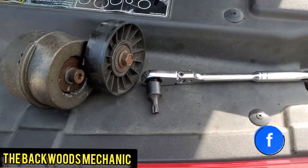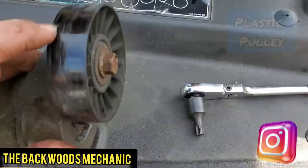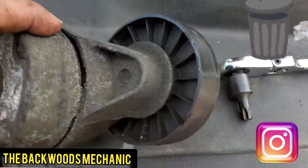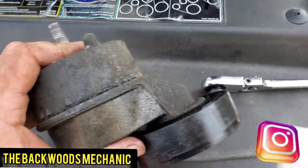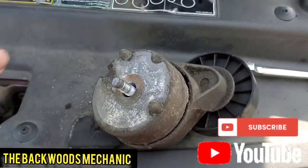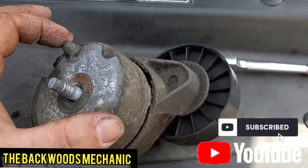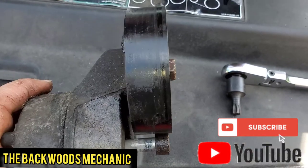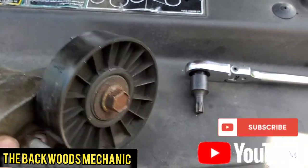Right here we go. I'm not saying that this is going to be easy, but it is doable and pretty convenient at this angle. Look at this - who puts a plastic pulley on here? It's plastic. That is junk. It's not really spinning freely like you would think on other tensioners. It feels lightweight, the guts and insides of it - you can see where it's corroded up a little bit. So you're going to want to go onto the frame of the truck, onto your engine where you're mounting this, and clean all that down nice and smooth because when you put this on, you want it to be flush. You want to put your two guides inside the holes they're meant to be in, and you want it nice and flush so when you put your belt back on, it's dead on.